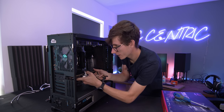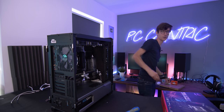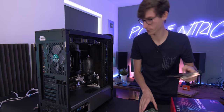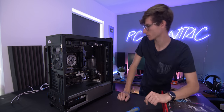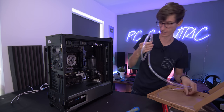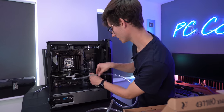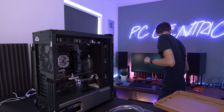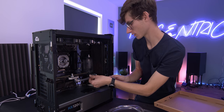We can now slot our GPU back into place. I really hope this chip works — if it doesn't, I will have egg on my face. I've obviously got my other PCIe cards but I'm not sure whether it's worth putting these in until I've leak tested it — I'll put them in after. We can now start building our loop. I know the runs, I'm used to doing this. I'm not reusing the same tubing, just to err on the side of caution. Always start from the pump and work your way around — you're much less likely to run into any leaks if you do that. Obviously the whole elephant in the room is that Ampere is right around the corner, and I don't want this to be too difficult to drain if I do get hold of a liquid cooled card next time around.